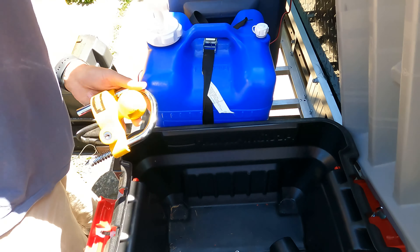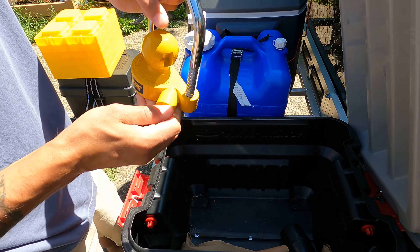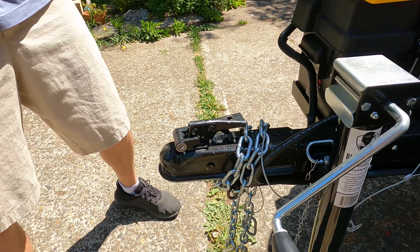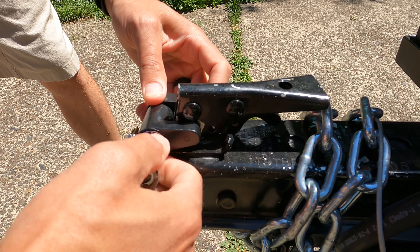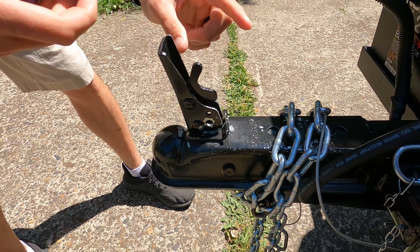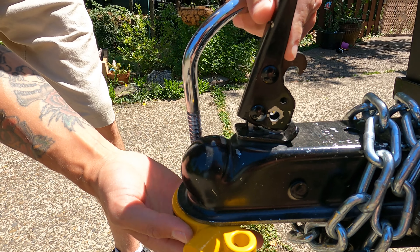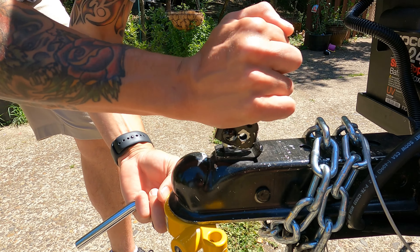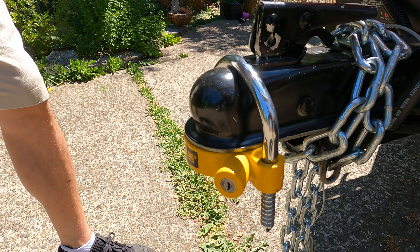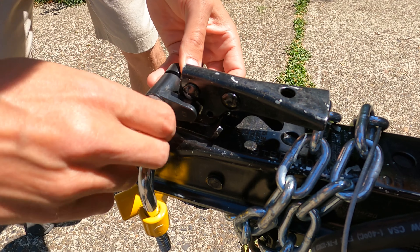If you're planning on separating the trailer from the tow vehicle, we ask that you use this additional hitch lock — keys are provided on the ring that was given to you. Remove the hitch pin lock with the key also on the ring, so that you can place this secondary lock into position. Attach the yellow portion just as you would if attaching the trailer to your tow vehicle, then ratchet the U-bolt into place. Be sure to replace the hitch pin lock also for added security, and so it doesn't go missing.